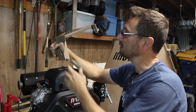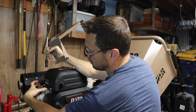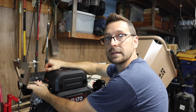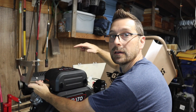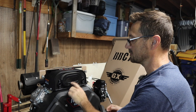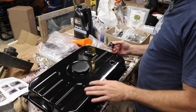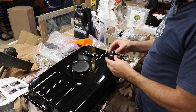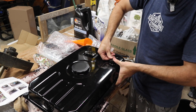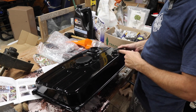We've got our battery on, we've got our fenders on. Now it's time to attach the two gas tank brackets, and those will sit on the brackets attached to the engine itself. There are two on each side and the gas tank can ride above it. Since it's designed like that, they did an air cleaner that comes out of the side right here. Almost everything's installed. Now what we need to do is put this EVAP valve on the top — it's just a press-in with an o-ring, so we're just going to press this into this top hole. That's a tight fit so be careful of the little barb connector on the top — you could snap that off.